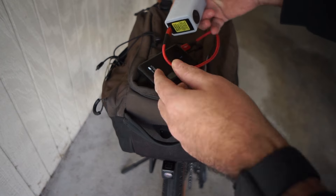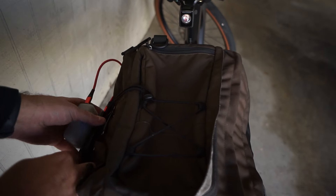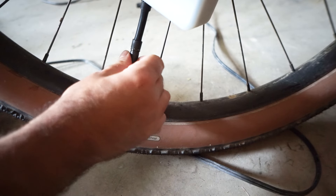There are some downsides — battery life and charges are obvious ones. When I commute I carry a small battery bank, but I had that before these pumps anyway. In most scenarios you're just topping off a plugged tire, not fully inflating from zero. And knowing you can do two, three, four, or five full inflations depending on tire size and volume is reassuring. A hand pump or full-size frame pump will never run out of air and will cost less unless it's a really premium frame pump — but the use cases for this system are clear.